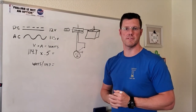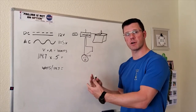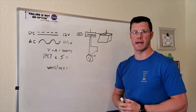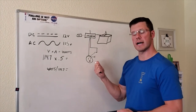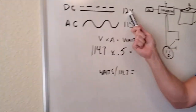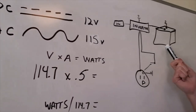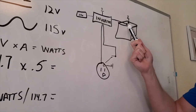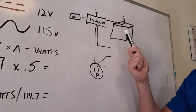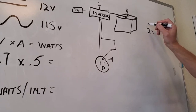Your Ram and Jeep truck have the power inverter — but how does it work? How do you take a car battery and turn it into 115 volts AC to power your equipment in the back of your truck? A DC battery provides you with 12 volts, which is standard for a car battery. Your car battery can provide up to 700 amps if you have the tow package, and that's 700 amps times 12 volts.